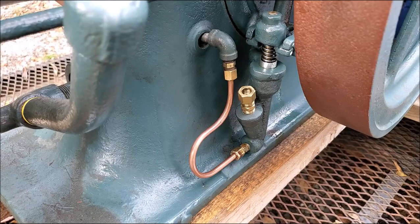Yesterday about sundown I went ahead and put that fuel pump on there. I made up a new line - quarter inch on that size - and made up another one coming out of the top to the mixer, three-eighths on that one. This thing has sat - I pumped some fuel through it yesterday, it's late in the evening again, day after. It's sat here a day and a night. So we'll just see how many strokes on that plunger it takes. I'm just going to put a wood dowel in and give her a couple of plunges to see how many it takes to produce fuel coming out of that fitting right there.